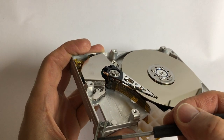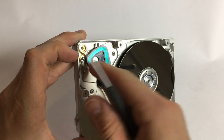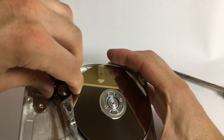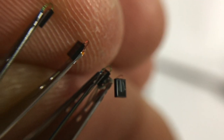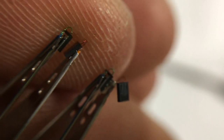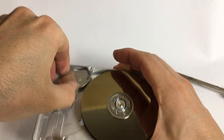There's a seal down here. This is held back by the magnets. There's a stop buffer — the end of the read head will hit against it to make it stop. Underneath is basically just a coil, and beneath that is a big magnet — probably neodymium or something like that. Here we have the read heads, with the cables going there to get the data — one for the top and one for the bottom. Then it goes down into this piece, which is probably just an amplifier. The disc rotates from here to there, and down here is the actual magnet — really, really strong.